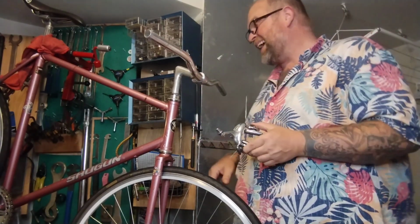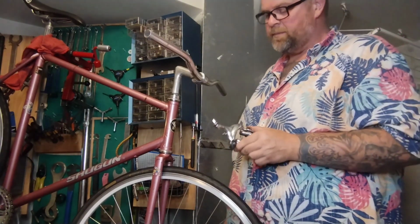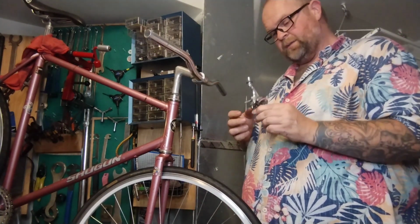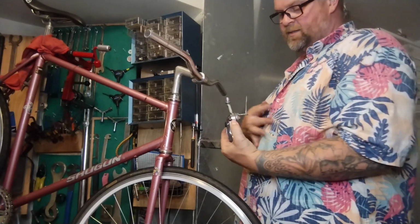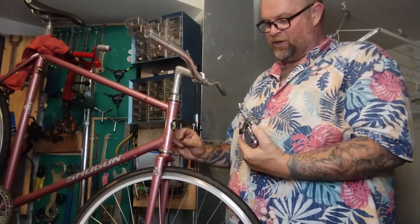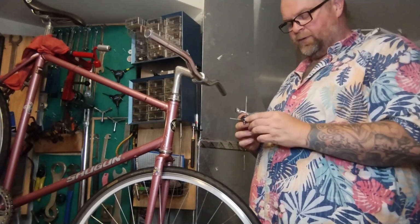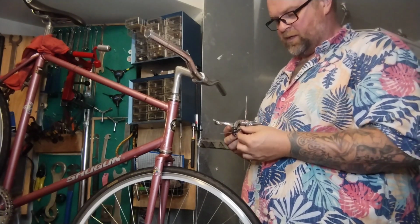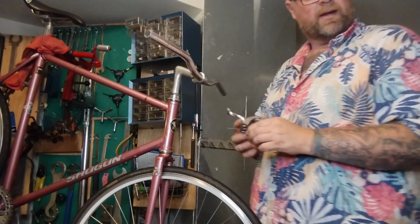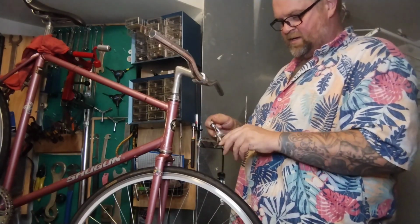It's a little trickier on the back if you have a real short drill and stuff, but it's kind of dumb. So what I'll often do if I do something like that is put the front on the back, because then you can get a nut on it. Put the back on the front with a drill hole, and you can use a really long recessed nut. And you can make a set of recessed brakes fit an old frame. It's a real common trick, and we may or may not be doing that. Or we could just drill this crown out.